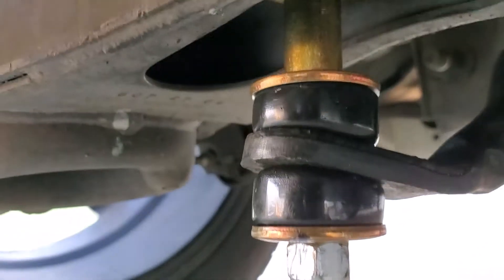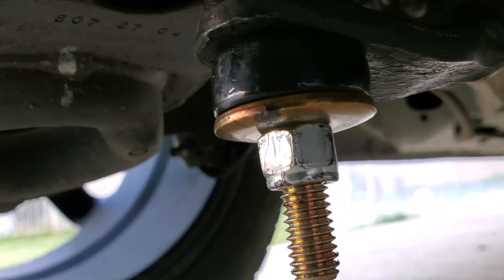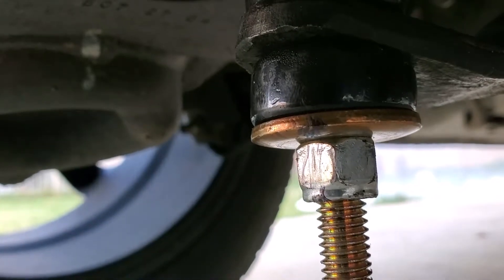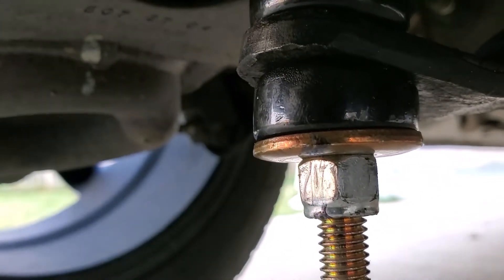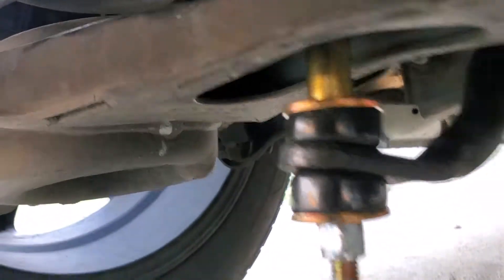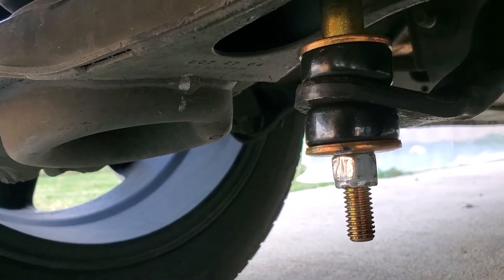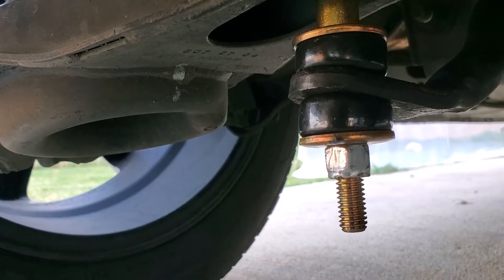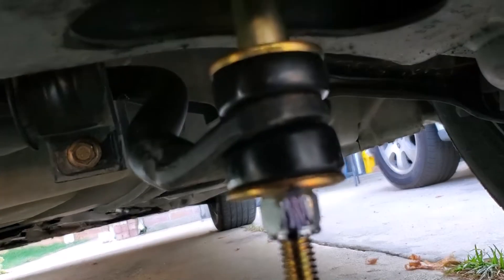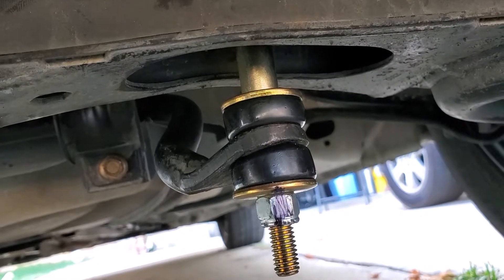The last thing I've done is mark the location where I've tightened the bolts down, so that if they come loose due to vibration I'll know when I look up under the car. It's a good practice to put a little color on your markings to see if your bolts are loosening up.